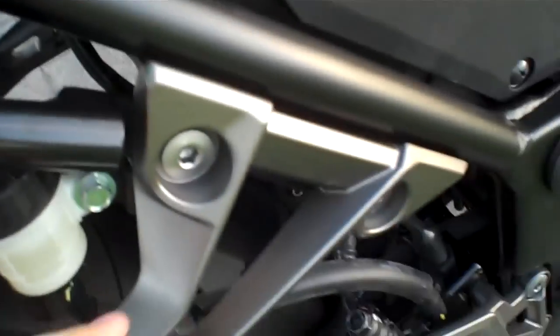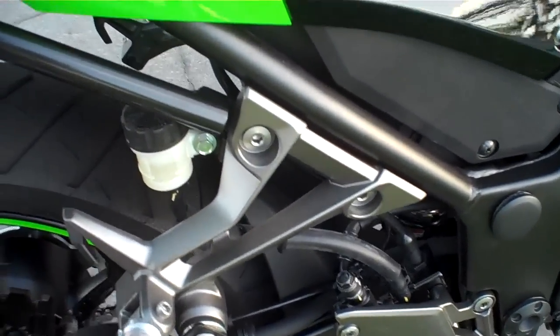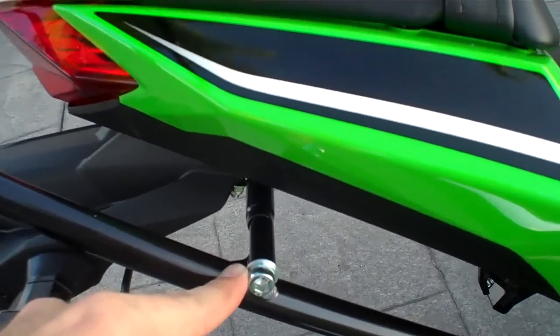There's just the one bracket with the bolt that comes in here on the side. You might be able to see it comes in as just the one bolt. It attaches via one bolt down here off the side of your rear pegs. When it comes back up there's a bolt through here that joins the side panels together. And then up underneath the seat, there's these two bolts here.